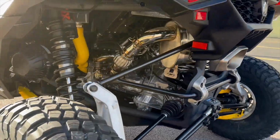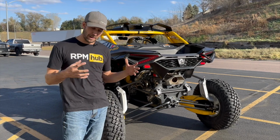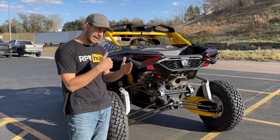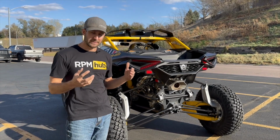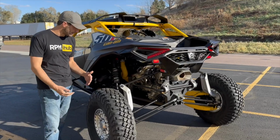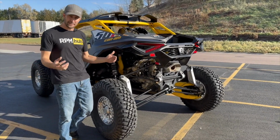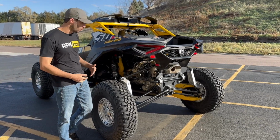So this is an internally mechanically chambered muffler, meaning there's a bunch of internal mechanical baffles, just a bunch of walls that the air is hitting, bouncing off of, going back through some fluted tubes, and we pretty much dial in the sound based off of how large those tubes are, the flutes, where we position them. It's still a free-flowing muffler. It's going to be a little bit deeper sound than stock, and that's kind of what we went for on this one. This is our quietest muffler on our whole little lineup.